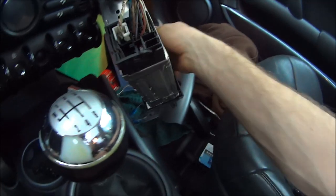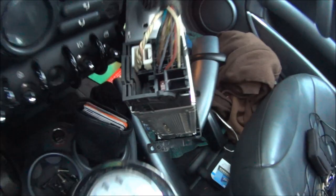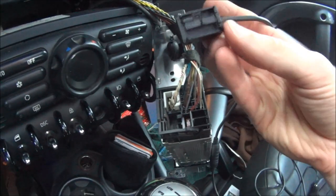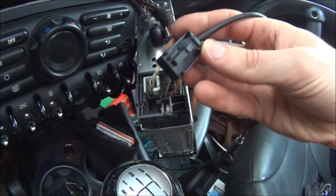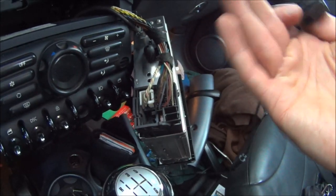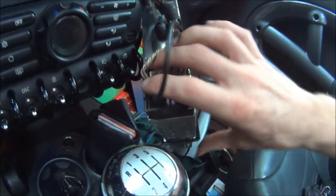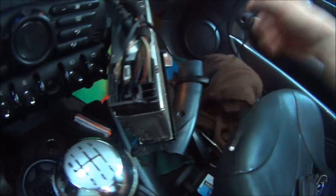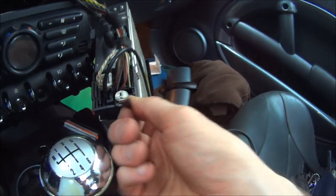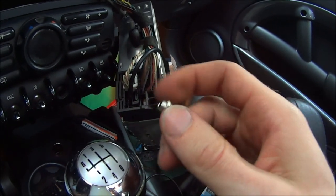If you look on this side, and if you don't have the CD changer, there's an empty plug right here. And the auxiliary port wiring harness, which I will post the link to in the description of this video, simply plugs into the radio, just like that. And now you're able to plug your iPod or whatever, or iPhone, into the car.